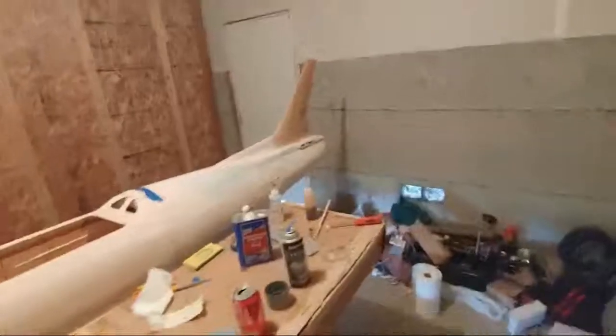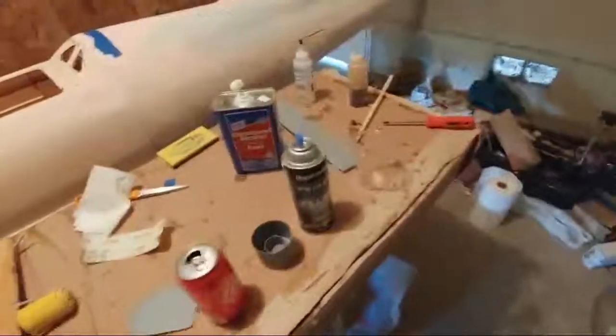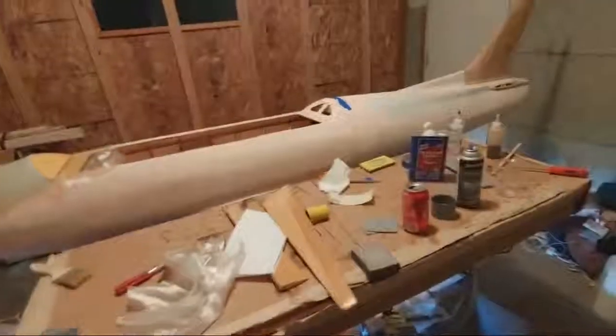But then we've got this, and this I moved in. It's fine. This is the first coat. And as you can see, guys, it turned out really nice. So we're moving right along. Before I primer a lot of this stuff, I've got some parts primered and some that are not. Now I'm using a filler primer, and guys, I'm going to show you when I block these. They look real nice and straight. I assure you, they are not. I mean, almost every bit of that primer will sand off.